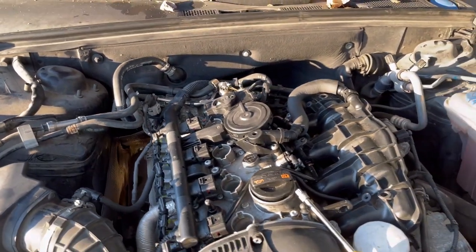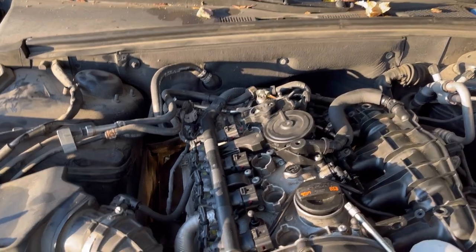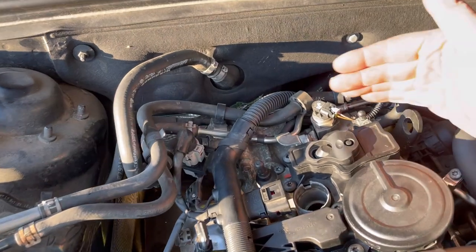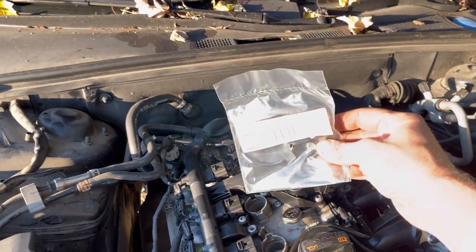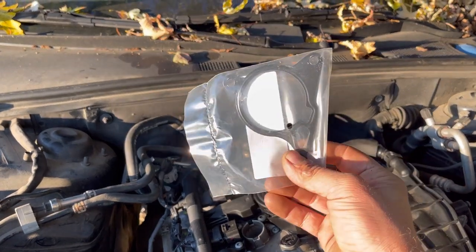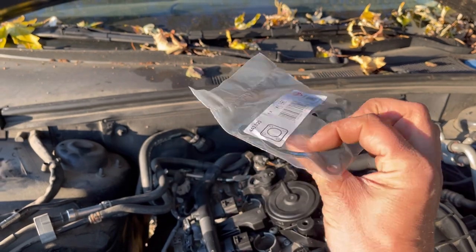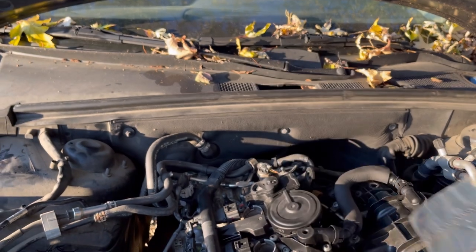The vacuum pump gasket is a common oil leak area. It's directly above the catalytic converter, so it's a very hot area where the exhaust comes out. This little gasket separates the vacuum pump from the cylinder head, and we have an oil galley hole right here, and also this center section has some oil sloshing around in it. You want to get a good quality three-ply gasket — none of those cheap knockoff gaskets.